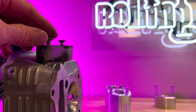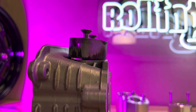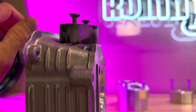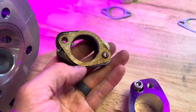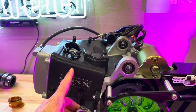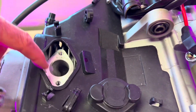For those of you that can't get your carburetor to run for the life of you, definitely check this. The way to check it is: let the engine run if it can, spray some carburetor cleaner in there — if it has a leak it'll suck the carburetor cleaner through and kill the bike, and you'll know you have an air leak. The other problem is it has a paper gasket — a lot of times you need to put some silicone on there so it seals. The big problem is it won't fit, so you'll either need to grind the head or grind the spacer to make it fit. Also, these cooling shrouds you want to keep on — you try to drop it in and it hits the shroud, so you'd need to dremel the shrouds out.